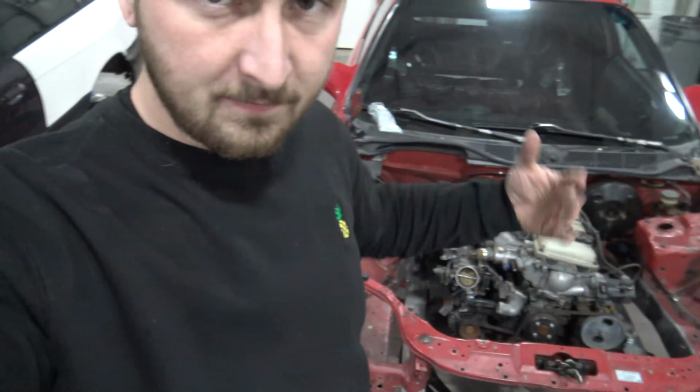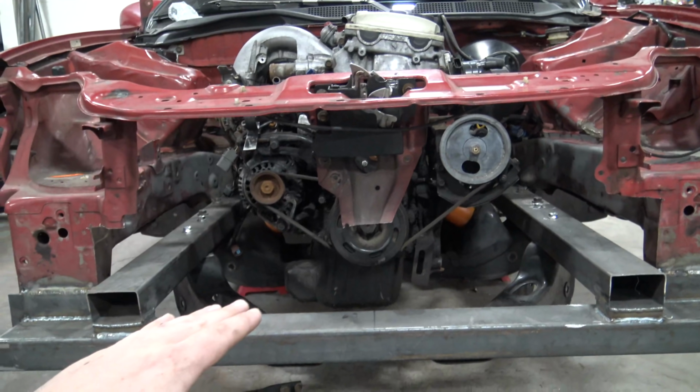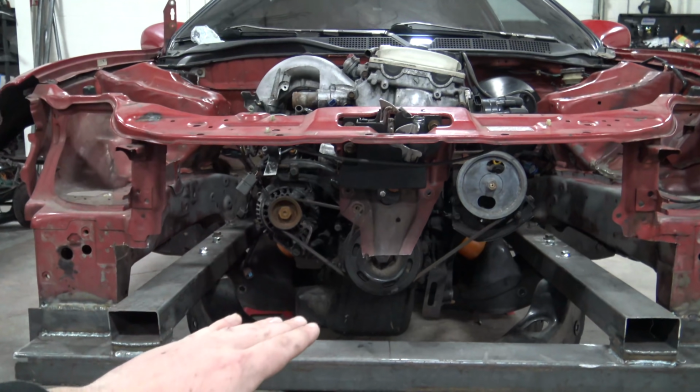I actually had a really hard time trying to find a radiator that would work on this car. At least an OEM one, because doing a full custom radiator setup is pretty expensive. So finding a cheap aftermarket OEM style one was definitely the way to go. So I went nuts, absolutely insane, trying to find an OEM radiator that fit in here for two main reasons. It's really wide, but it's not that tall at all. Like you have like 12 inches. A stock 240 radiator is like 16, 18 inches tall. It's a big difference. We'd have radiators sticking out the hood.